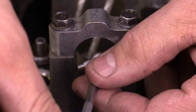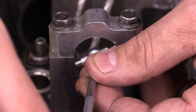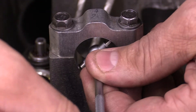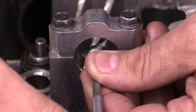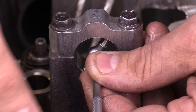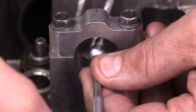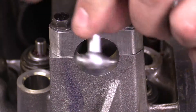I'll be measuring the bore of this main bearing — this is the number two main bearing for the camshaft. I loosen it up, slide it in position, rotate it slightly to avoid the oil passage, and begin to tighten it up. I want to make sure that I'm perfectly perpendicular to the cylinder to get the appropriate diameter, and then I lock it in place.